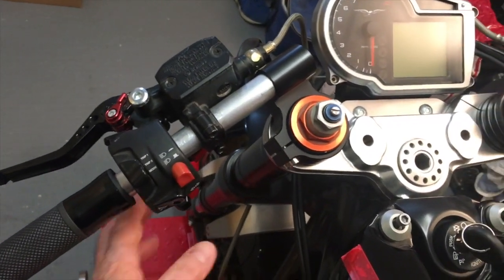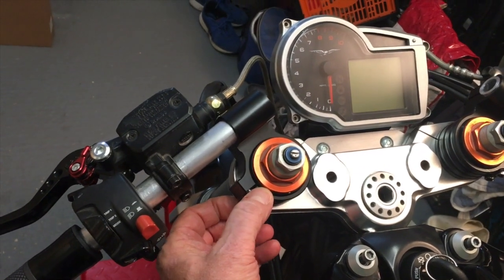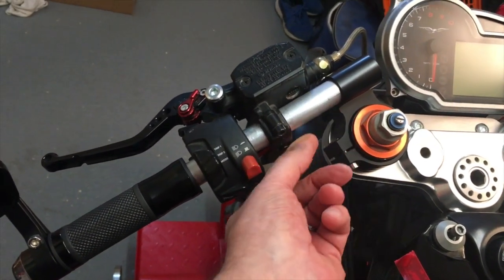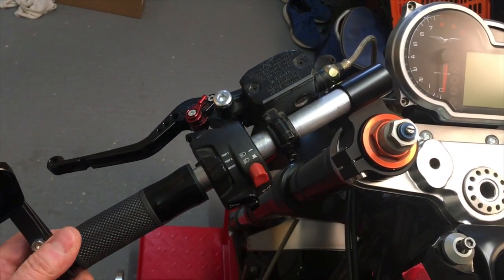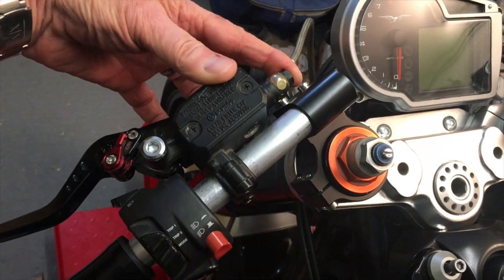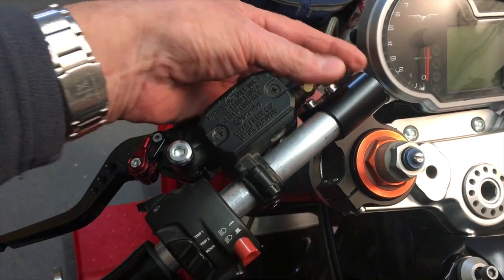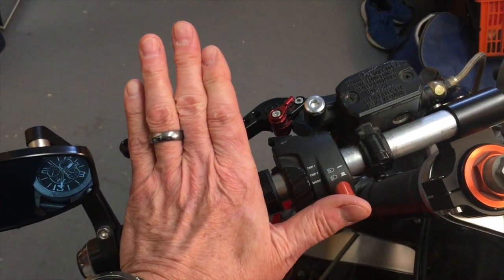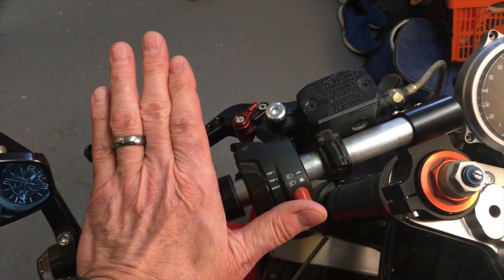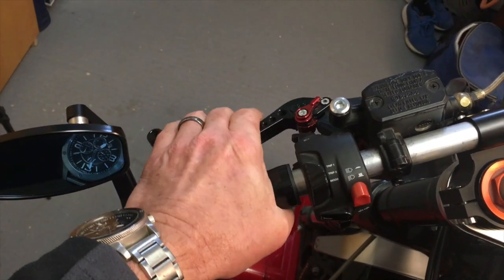I've put the clip-ons on and they're on the top of the fork - the forks have been dropped down about 45mm. The actual bars themselves were black and anodized but I had to replace them because they weren't wide enough, and the master cylinder was hitting on the bolts for the clip-ons, which meant the levers were too high up. So I've replaced them with some equivalent three millimetre aluminium tubing, made the bars two inches wider, and now the levers are in a much more relaxed position.